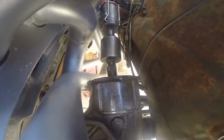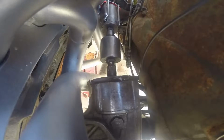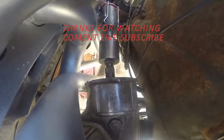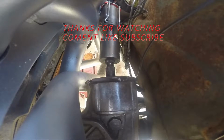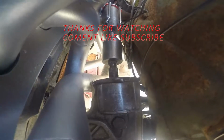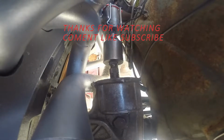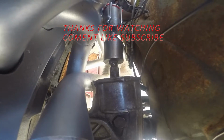You also want to make sure that your wheels are more or less in a straight position, and your steering wheel, of course, you want it close to where it's going to be right in the center. Otherwise, when you align it, you'll either be turning right or turning left. But that's an adjustment that's easy to do.